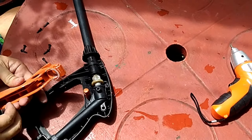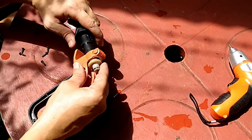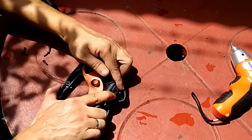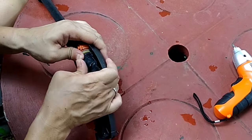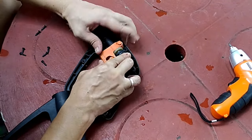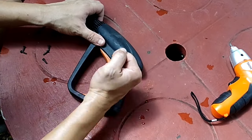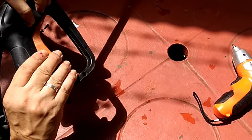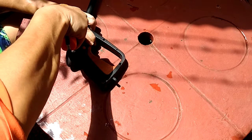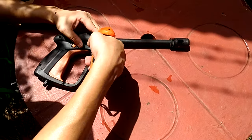I gotta be honest — it's so much harder putting the assembly back together. One, we have to align the parts to the respective slots, and two, the spring in the stand is creating an outward tension that makes it difficult to hold everything together all at once. And with a lot of wiggling and a lot of patience, the parts begin to cooperate. Let's replace the cover and screw everything in. Let's put back the screws in a criss-cross pattern to make sure we mount the cover evenly.